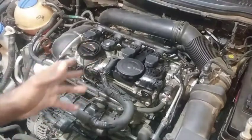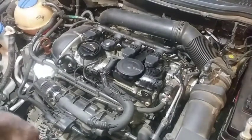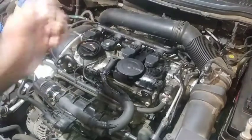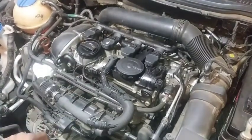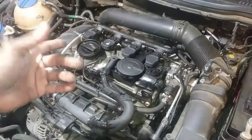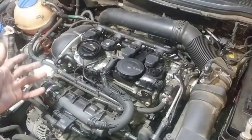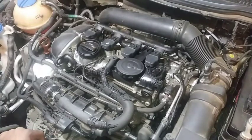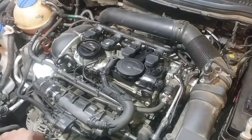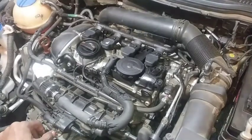The problem comes into play on extremely hot days - 110 degree weather - that may become a problem. But this is North Carolina, we don't have those type of days. And for the most part this car runs rich, the compression's low. So we're not going to have crazy issues like that with the hotter plug. Being that the compression's low, you have misfires with lower compression - you're going to have issues with that plug igniting.